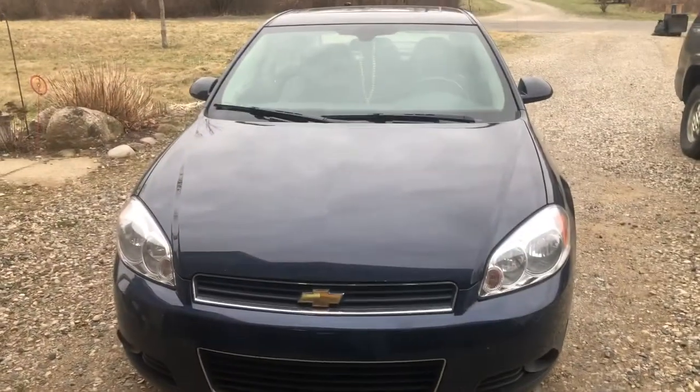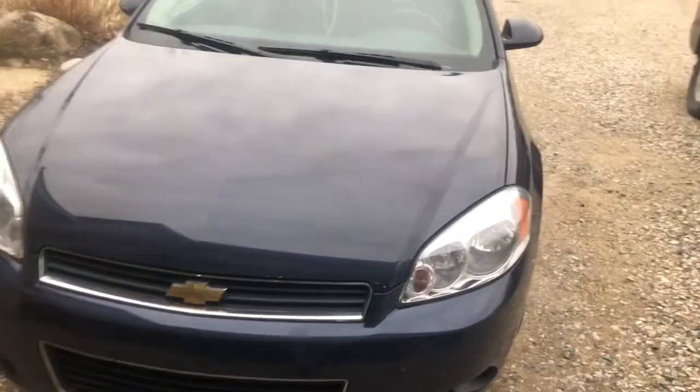That's a quick update on what's been going on. This is basically what's been occupying my time — the bodywork on this side. Funny little story: the weather was really nice the other day and I had to do an oil change in Iris — my wife's 2008 LTZ. She's also got the dreaded Service Stabilitrak. The ABS sensor wire on the right front has got a break in the wire — it's a common problem. My code reader tells me which wheel it is and you just get a new wiring pigtail from AutoZone or Amazon and wire the new pigtail. Chevrolet designed the harness too short, and when you make hard turns it stretches the harness and leads to the wires breaking.